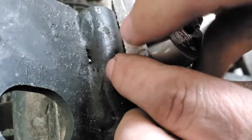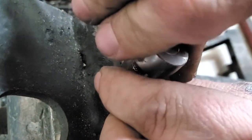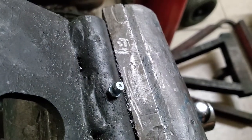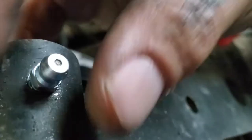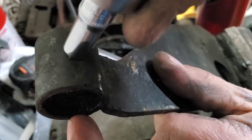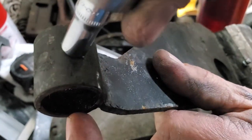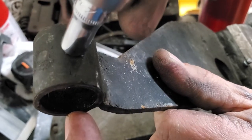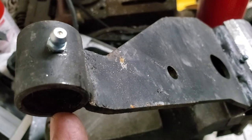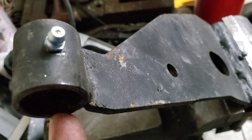Now we have a way to grease it. Some folks in the business, or even somebody with an older Club Car DS, will remember they have bronze bushings in them — and when you see those cars today, they're still there, everything's still put together and working. That kind of stuff really held up. On these cars all this new rubber stuff is just failing left and right and making our jobs harder. We wanted to go bronze here, but we could not.